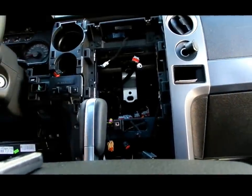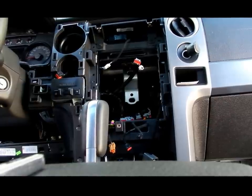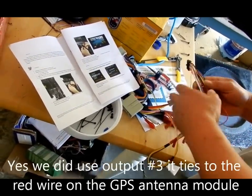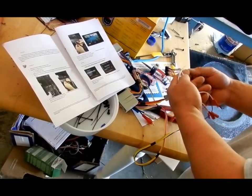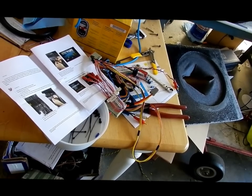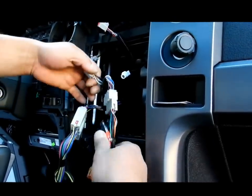Let me hand this to you back here. Well, there it is — out. What's with the NAV TV piece? The NAV TV piece is sitting on the workbench. Look, we read directions — directions, directions. We're not using any of these? Input, input — yeah, that's data. Output. So these are inputs and outputs, so we don't need any of these. So all we got to do is just extend those two wires and run them in. Sounds easy — extend those two wires and run them in. The connectors are pretty much self-explanatory; they'll only go one way.